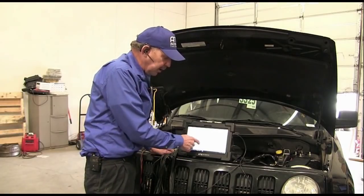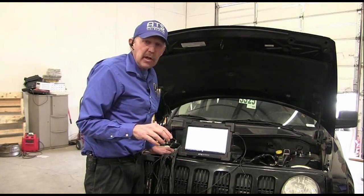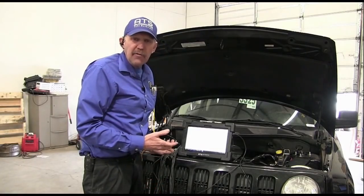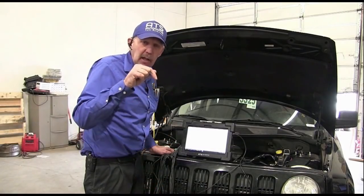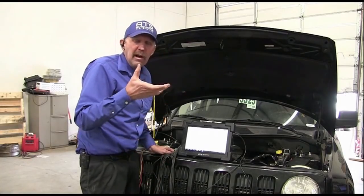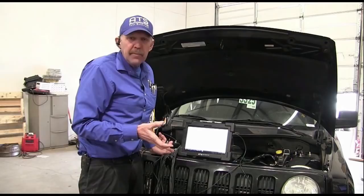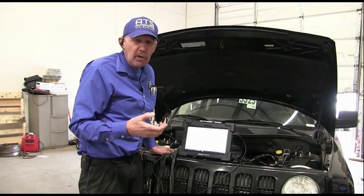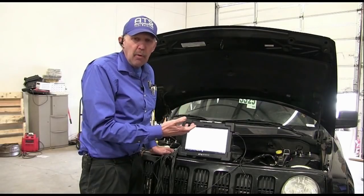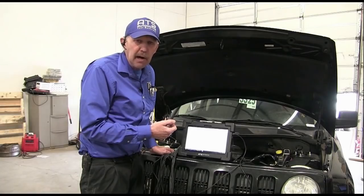So all the coils are wound like this. That's why when you guys see coils that are going bad, you get a big spike down like off of the injectors, and it'll go 100, 140, 300 volts negative. Whenever you have large negative spikes on the scope, and they're 100, 200 volts, that's a coil strike leaking into the system. And that will create havoc on a computer. It'll shut them off and give you all kinds of problems.